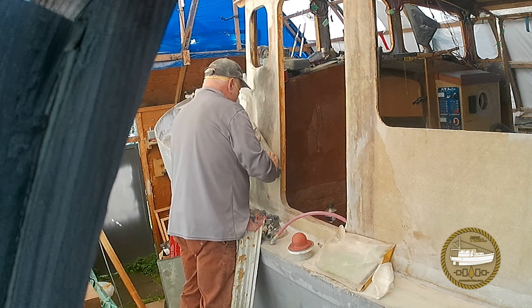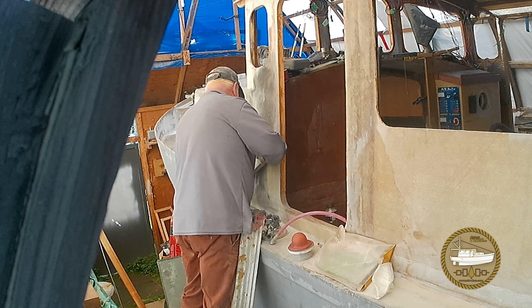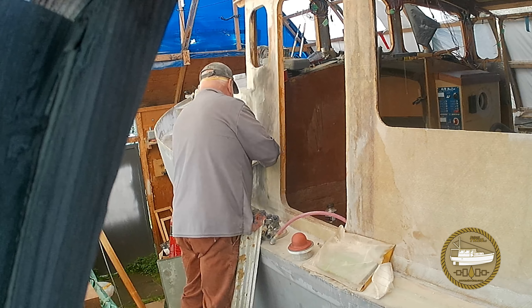I gradually got the defects down to a size where you can't see them. You can feel a few edges sticking up, and with a bit more sanding and a little bit of glazing compound, it's totally gone. You'll never see it once this area is painted.